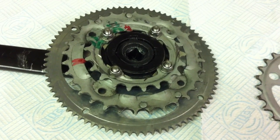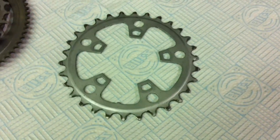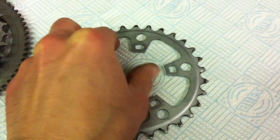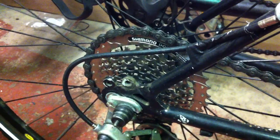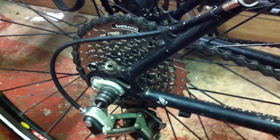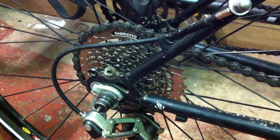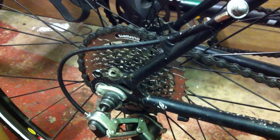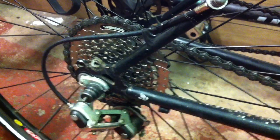I went out on the Ulti bike this morning with a 30 on the front and a 34 on the back, and we got 35, maybe 36 miles an hour with this gear. But that means none of the rest of the cluster is going to get used — in theory we were geared for about 50 miles an hour, so we haven't got enough torque. There's no point using 30/34, so I've decided to go smaller on the front.